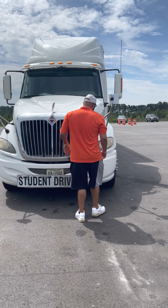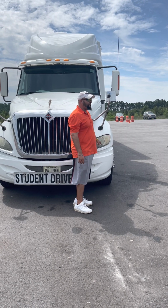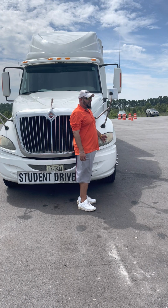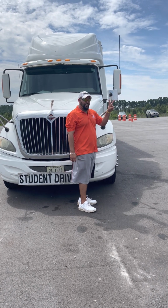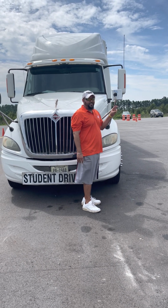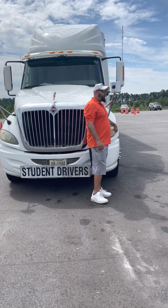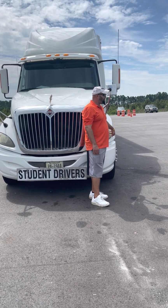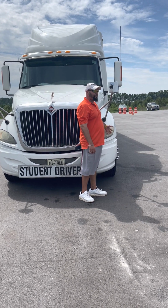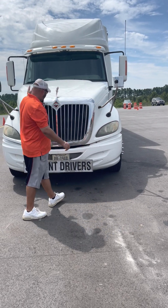Now I'm gonna go to my lights here. These are my high beam, low beam, four-way hazards, and turn signals. You got to mention all that to get credit. High beam, low beam, four-way hazard, whichever one you say, hazard or four ways. I say four ways, and turn signal. Turn signal four ways are amber in color, not cracked, broken, or missing. My headlights, not cracked, broken, or missing, and they are clear or transparent in color, whichever one you want to say.